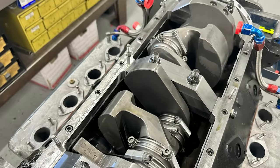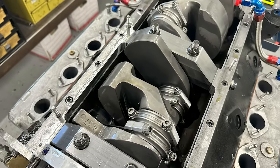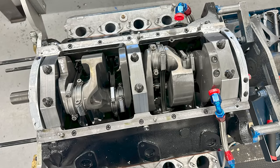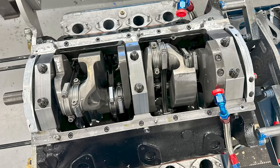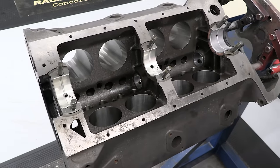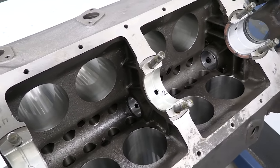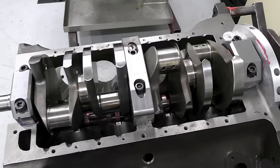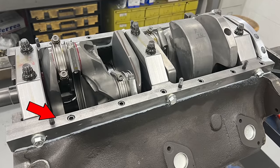This engine is being built to race in the XXF engine class. The XXF engine code requires a stock block from either a Ford or Mercury flathead with an overhead valve conversion, so we've got to start with a stock block, which you can see here. Even if you can find an original block that's not used up or doesn't have casting issues, a serious design issue that really limits power is it only has three mains securing the crankshaft — compared to the five that's normal in modern V8s. Many people have tried strengthening the block by adding a main girdle with two additional mains and a custom crankshaft, but Dorton says he's found that once the engine goes through a few heat cycles the girdle tends to lose alignment with the block's mains, which can drastically increase heat and parasitic drag.